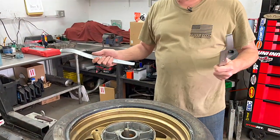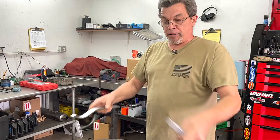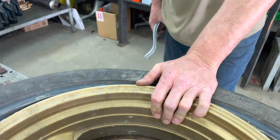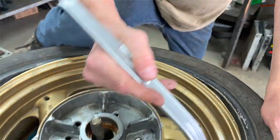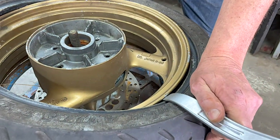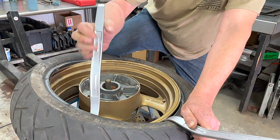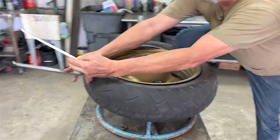You can use either side — it works, everybody's a little bit different — but this tends to work better on these larger tires. So what we're going to do is get it started, just kind of down below the wheel a little bit. I tend to just put my knee up on it to hold it, and then we'll catch the tire like that. This is where you may come to need three — two will work it around, but you may need a third to hold it in place. As you can see, it kind of contours with the tire a little bit better.